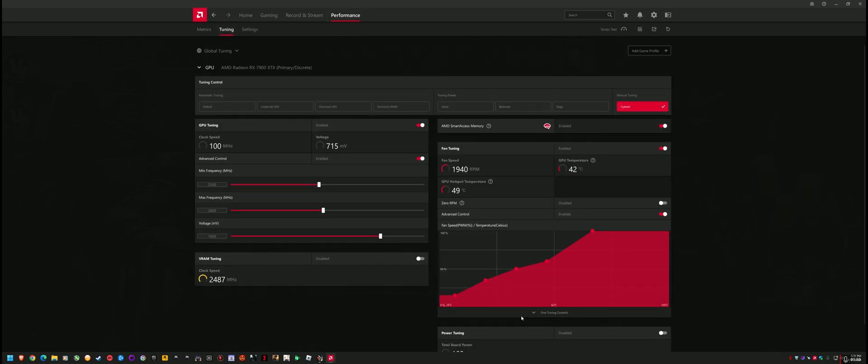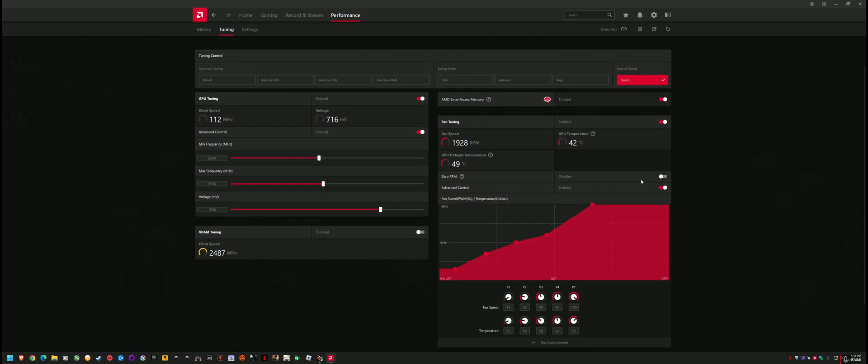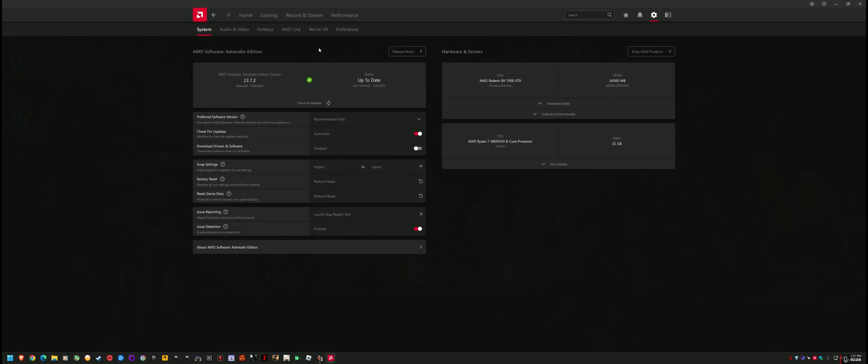On performance tuning, nothing changed there. I set my own fan profile as well, just because it comes with zero RPM enabled and the fan set to ramp up at like 90°C or something. I like to run my cards cool because fans are cheap to replace, and the GPU dying early is obviously much more expensive. These are the temps at desktop, and I'm recording with AV1 because the 7000 series does have AV1.